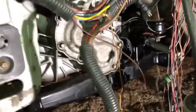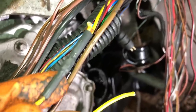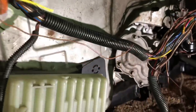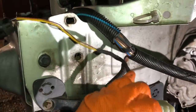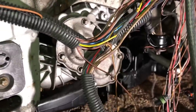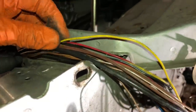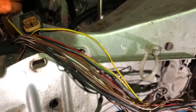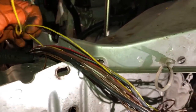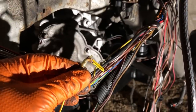A lot of these wires are tight because they all share the same connector. I've just chopped the yellow power wire off these - they were obviously going to be pointing backwards. I'm going to cut this slot off. As soon as you cut that, you're free and can get right up to where the headlight is. Instead of the joiner being up there, I can join it in up here and it's a lot simpler. The wires were attached at a joiner that goes all the way around to the other headlight - since they work simultaneously and that side was shorter, I can now just attach the yellow wires at this section instead.